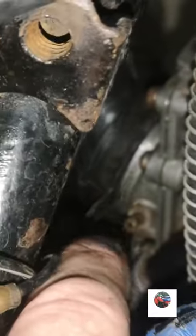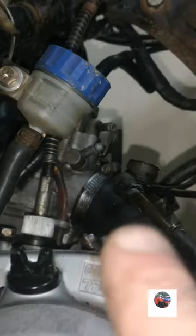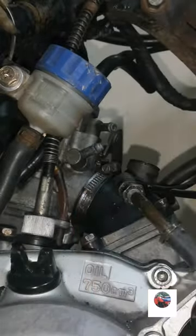Put the bracket on the back of the air box. So we've got the air box boot on now. If you can see there, just needs pulled on a bit more, but I'll get that on. But we'll get all this on now. I'm going to put the boost bottle on now as well. Just remember to slide the Jubilee clip round so you can get into the screw.